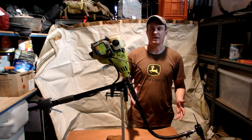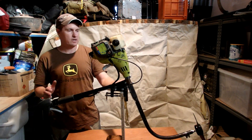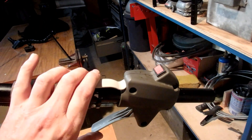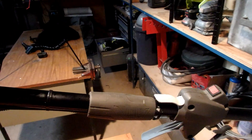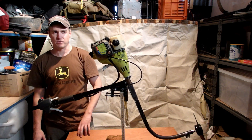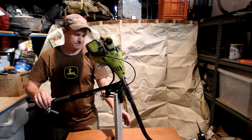It couldn't be simpler to modify this whippersnipper into a little DIY two-stroke outboard motor. For the outboard handle, I've actually reused that middle section from the whippersnipper. The good thing is it already has the controls built into it — you've got the throttle and also the kill switch, which when you're operating the motor are in perfect easy reach. It all fits back into the original slots, and having it set up like that gives you really good access to the motor start pull handle.